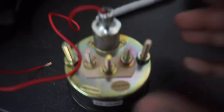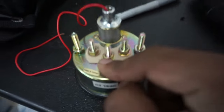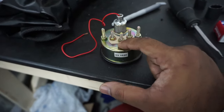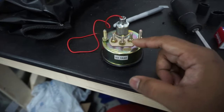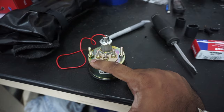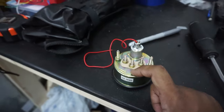These two on the outside are going to be our mounting points. We have our LED power and then we have our ground and positive, and then the signal is right over here. So basically the signal positive goes to the positive on the fuel sending unit. This ground and both the LED power terminals are going to be wired to power. Both positive and negative go straight to the battery, and the ground on the level sending unit also goes to the ground here.